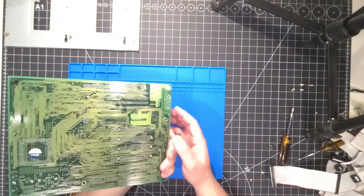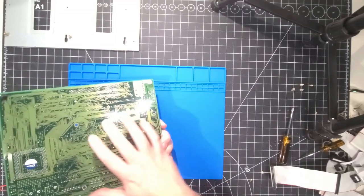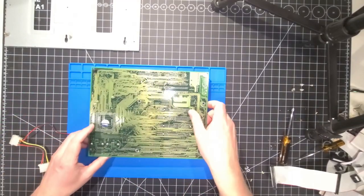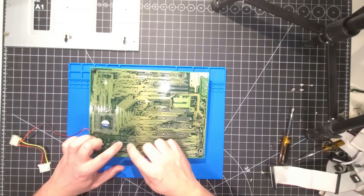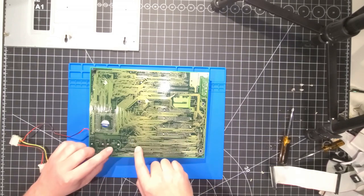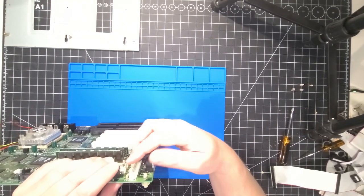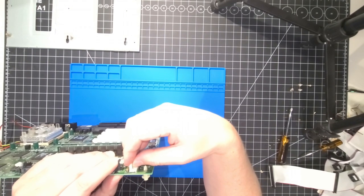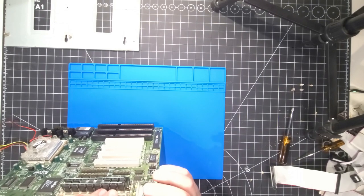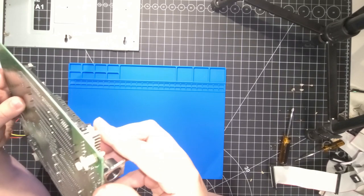Here we go — there's the back of the motherboard. You can see the rubber feet, the standoff that locks into the back plane, and the four screw areas. The Dallas real-time clock chip is right here — this row of pins here and the row of pins right here. I'm just going to look at the power while I'm here — I was a little concerned about how flimsy that connector was. The actual pins themselves aren't moving; it's just that when it was soldered onto the board originally, probably from factory, it seems to be a little higher than the actual PCB. That just gives it some flex, which may not be too concerning for the amount of times we'd actually be using it.